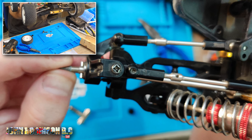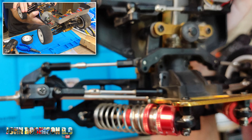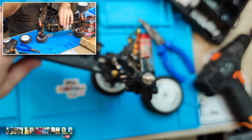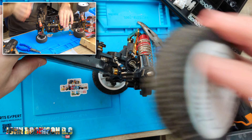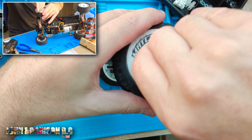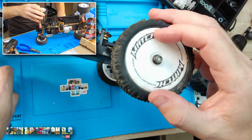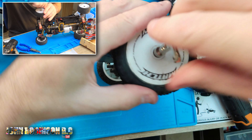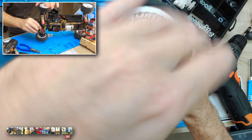There is no more play — the play is almost gone. You need to have a little bit of play there, because otherwise it will be too tight and the wheel won't turn. You then put the hex back on, put the wheel back on, put the wheel nut on. If you are the type of person that likes using thread lock, put thread lock on — I'll put some on later. Tighten it up, but do not tighten them all the way. These cars do not like that at all.